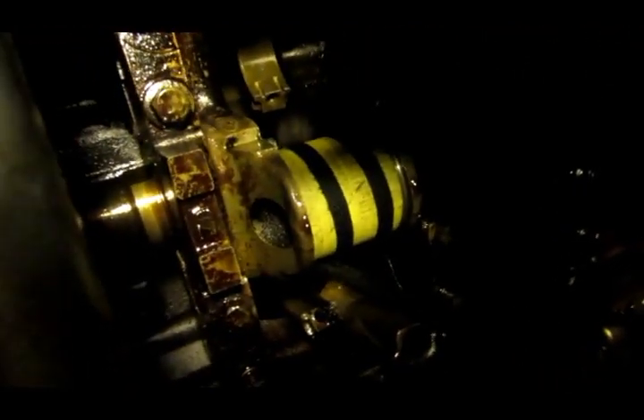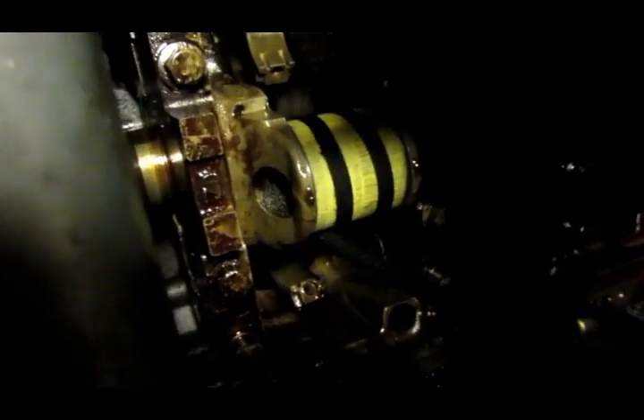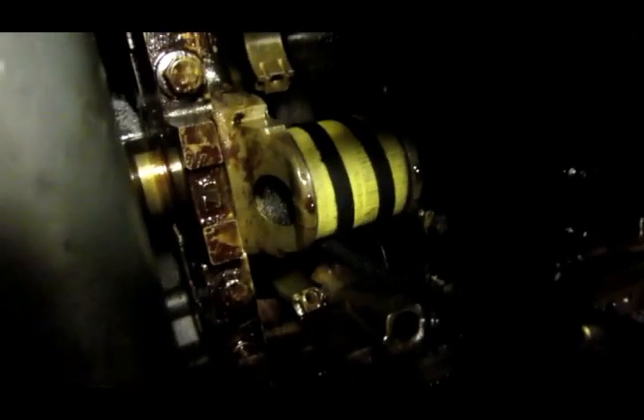I have some 400 grit and a shoelace. All I do is keep going back and forth - that's polishing the crank back up. After I got all the bearing material off, most of it was pretty clean. But there were a couple spots where I scraped the aluminum off with a razor blade and scratched the crank. So I'm polishing the crank - it's the old shoelace deal. You wrap it around the journal and pull back and forth to polish it.